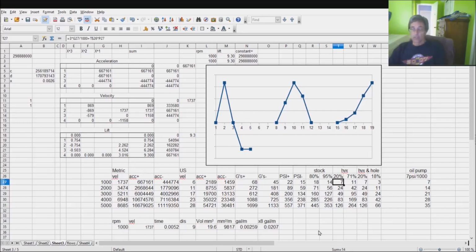So then you Hoover mod. Now when you Hoover mod, it of course takes, let's go back, it takes the little hole that sits right there, and the oil pressure that would ordinarily build up inside this band right here, it's now allowed to bleed off. So you effectively get no oil pressure except what you get from the oil pump. Plus a little tiny bit, I've allowed you 20%. There is some friction, so you will get some buildup, but it's not significant down low.